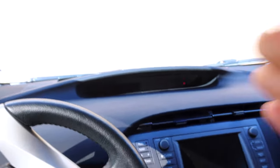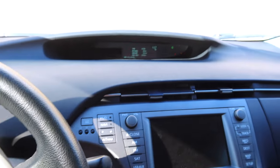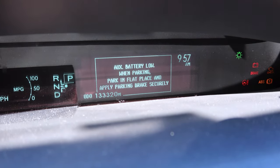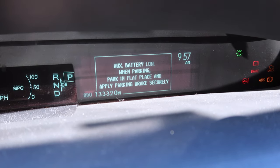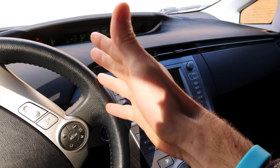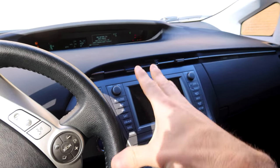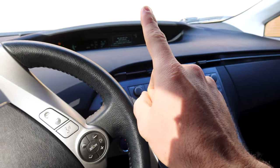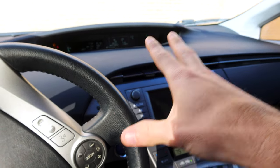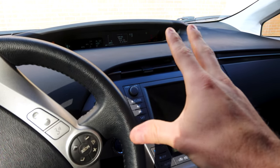So this is what happens when I'm trying to start my car. When I put my foot on the brake and press power, it says: aux battery low — when parking, place in flat place and apply parking brake securely. So what that means is our 12-volt battery, which is in the back of the car, is no longer working. It's old — maybe five years old — and we need to start the car. It needs to eventually be changed, but you can bypass it for a couple of days, maybe a couple of weeks, maybe a couple of months, but you should replace the battery eventually.